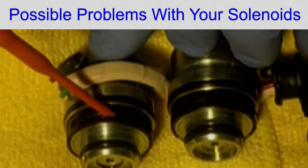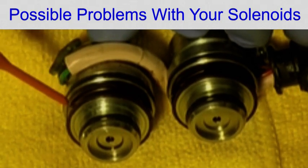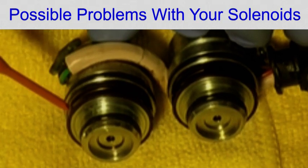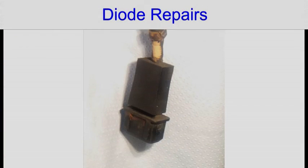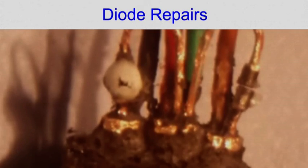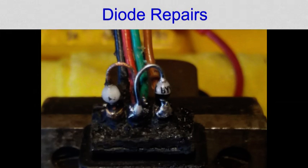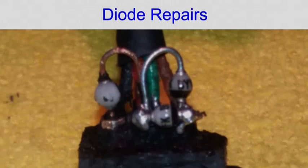These gaps here were originally, when I took it apart, full of what looked like a very fine filter but I suspect it was old engine oil. I stripped down the plug using a Dremel and found this inside. After a lot of investigation I decided that the ball was a sintered glass avalanche diode. There were no markings on it but I decided that a max current of 2 amps should be enough. I soldered in a BYW32 diode and then decided that doubling it up should definitely be safer for the engine management system.